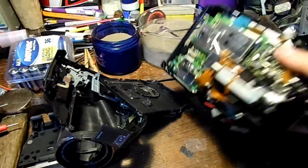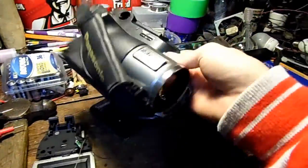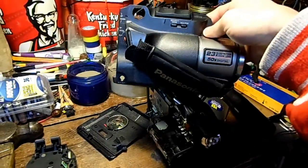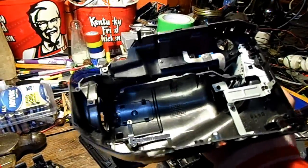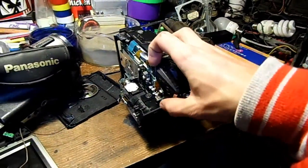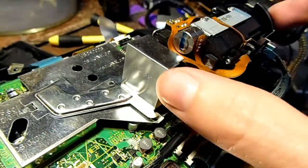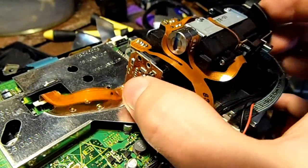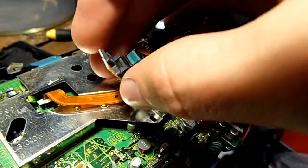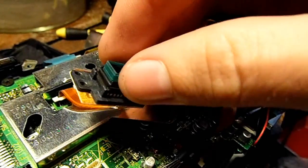Here's the main body with the camera attached. Interestingly, this was made in 1998 and I have about nine of these cameras so far. This is the camera/VCR off-mode switch, and what it does is move a pin in there that manually opens up the shutter. Here's the lens system, and on the back you can take off the shield - there's a circuit board connected to the back of the lens system. The entire lens system is kind of freestanding on rubber bushings, and after removing the screws you can see the CCD chip back here.